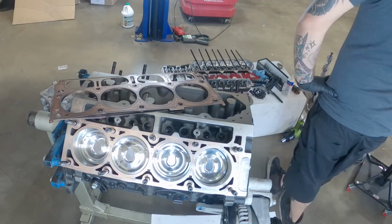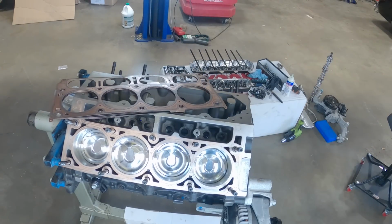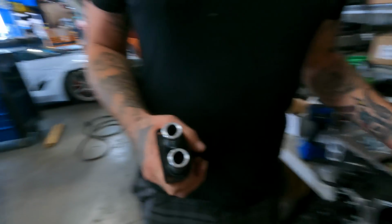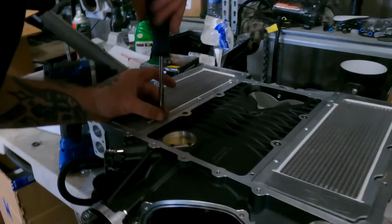Cylinder heads were done with a nice Maggie 2650, and his goal was just to have a reliable car on 93 octane, and it makes what it makes with a manual transmission. So we put a nice clutch in it. I want to say he brought us a clutch, if I remember correctly, and it wasn't the right clutch, so I think we put a Monster triple disc in it. I think we did LT4 injectors, LT4 pump on 93 octane with the 2650.